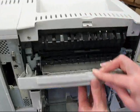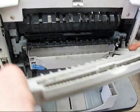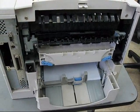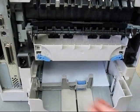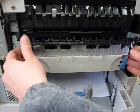Flip open the rear exit door, press in on the left, and then the right will come out. There are two tabs on the fuser — flip those up. They will unlock the fuser and you can slide it straight out.